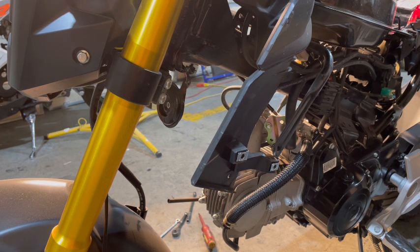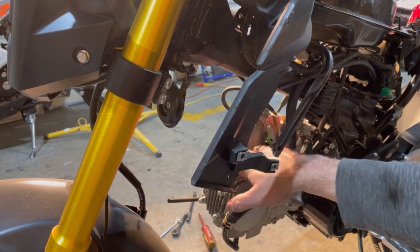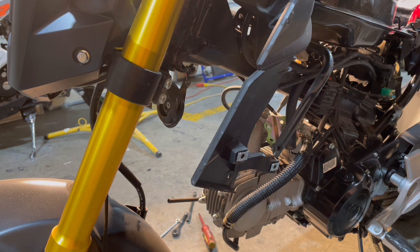If you were about to delete this and you wanted to get rid of this, you could, but you would have to block your intake line here so there was no suckage here. And you would have to cap this line off into the engine here. And then you would be fine. But other than that, that's what we had to do.